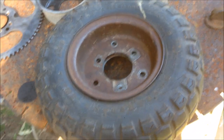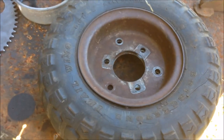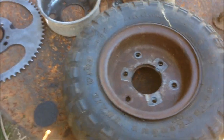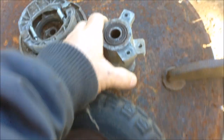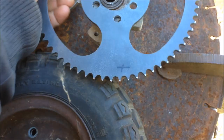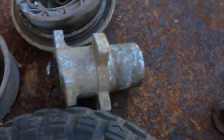One of today's challenges is to get this tyre off the rim because it's rusted on and too small. To give you an idea of what the right tyre is supposed to look like — there's the correct diameter and it just dwarfs it. The other problem is this was supposed to be a Dexan wheel, but it doesn't work with the Dexan sprocket — none of the holes line up and the centre is the wrong size. So that hub is correct, but the sprocket is not.